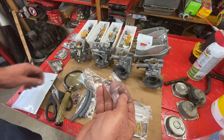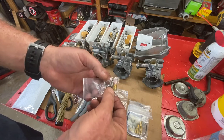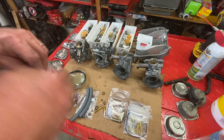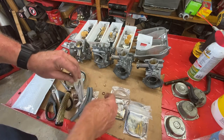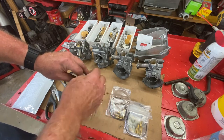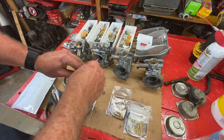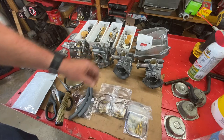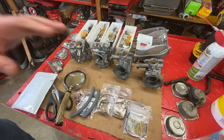In this kit, unlike the one from V4 Dreams — because I don't think he carries it — I have the needle seat for the float and the needle. We will be using those from this kit. That was the main reason I got it. Why did I source from a couple of different places? The main reason is I always go OEM first — for my own stuff especially, or for a customer who wants that. Nine out of ten times I go OEM for carb parts.